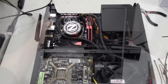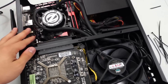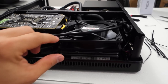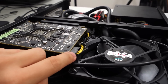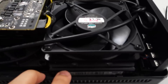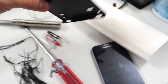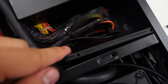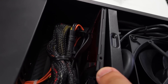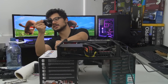Here she is — look at that. I got the CPU block on there. You can see I kind of tied down one of the tubes here to keep it from sticking up too far. The fan I went with ended up being that Cooler Master one from the Neptune 120 XL — a regular full-size 25mm thick fan. I just barely made clearance with the PCIe Express cable, probably like a millimeter, but it's not quite enough to cause any torsion on the PCIe slot. The radiator just fits so perfectly but just barely. I did have to remove the entire drive cage to fit it, so I've got my SSD sitting next to the power supply now.